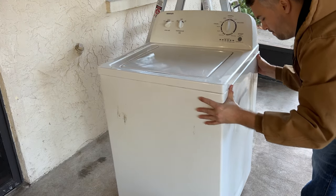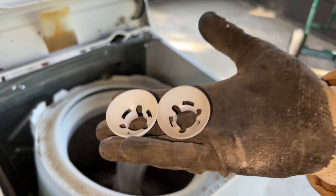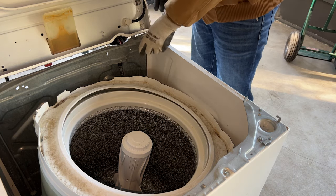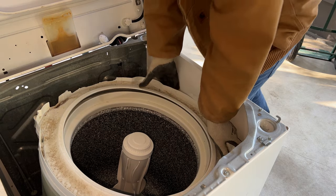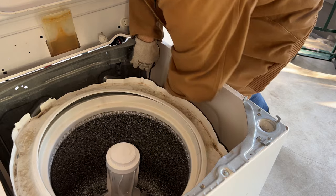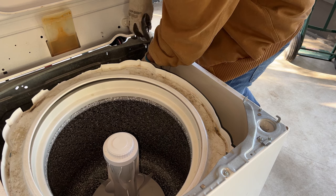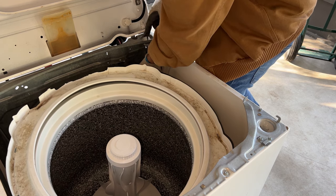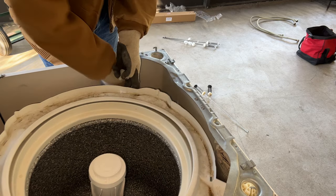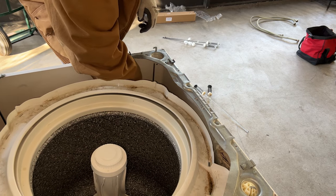I was able to gently set the washer back down and open the top back up again. As I mentioned, the kit included these little plastic cups — I don't think they were especially critical to the repair but it came with them so I installed them. Then I pushed the tub over to the other side so some of that weight would rest on the rods that were still in place. I reached down inside of the washer, grabbed the first rod, pulled it up through the hole, and secured it in place with the top plastic. Then I repeated these steps for the second rod — it's definitely a lot easier with the other three out of four rods supporting most of the weight from the tub.